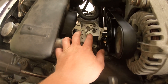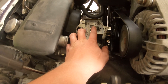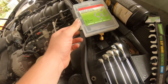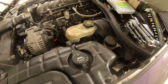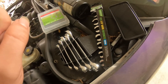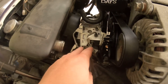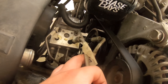First we're going to start by removing the front end and rear end lines to the valve. I bought some vacuum caps to plug those lines so that the master doesn't drain all the way — it'll make bleeding the brakes a lot easier. I'll be using line wrenches and also some crow's feet flare nut wrenches for lines I can't reach with the line wrenches.